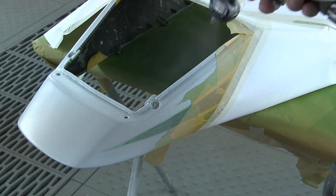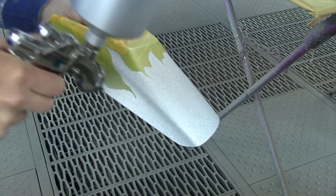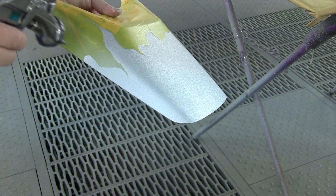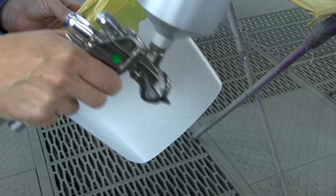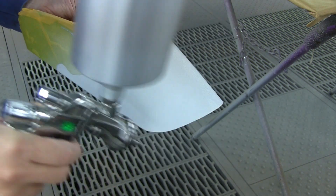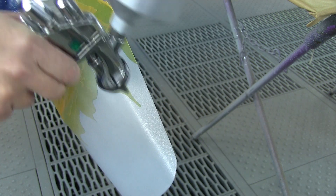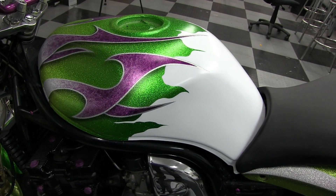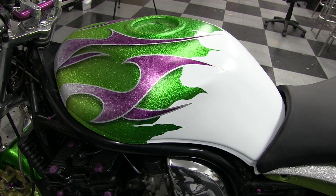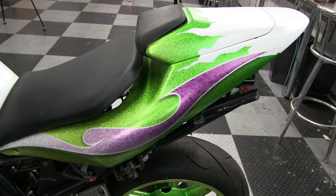I want to spray it completely white, so I'm using Autoborn Sealer White 6001. I've used the clear and now I'm using the white — I want completely rid of the flake. I'm going to put some monochromatic artwork on here, and the last thing I want to see is flake coming through in the sunlight, so I'm totally neutralizing it with the Autoborn Sealer White. I'm spraying away from the masking to try and discourage any paint creeping under spray. I've only put two coats on here, but those two coats have completely neutralized the flake.